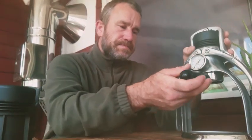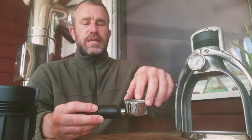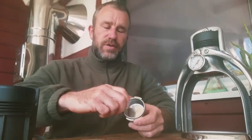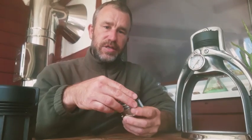Okay guys, tip number two — this is easy, you don't have to change anything at all with your rock. It simply involves how you use it. Your portafilter basket has a ring that holds it in the portafilter so you can knock your pucks out easily, which is nice, but for this machine it's not really the best way to do it. If you get a screwdriver, you can wedge it in here and very carefully peel this out — there's a ring in here you can remove — and now the basket goes in and out very easily.